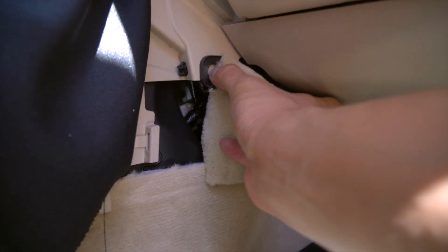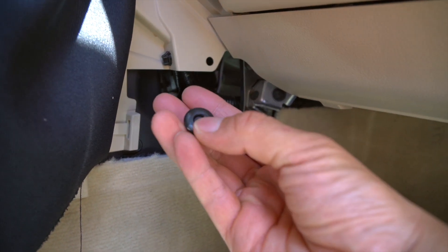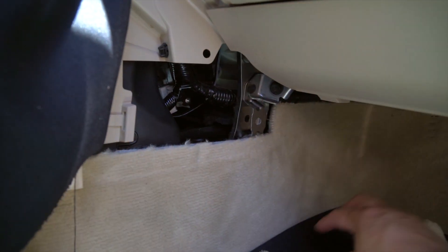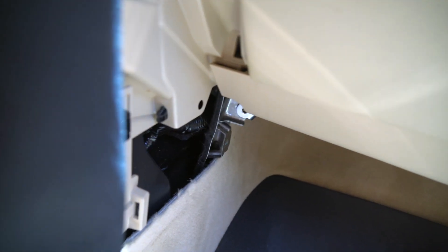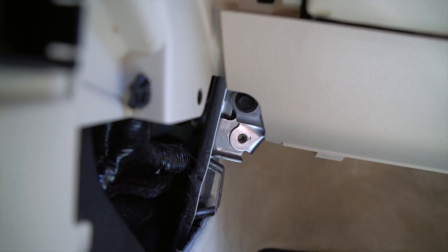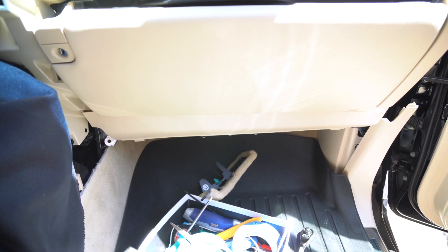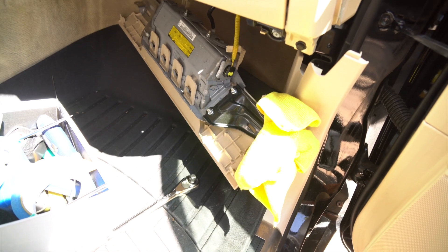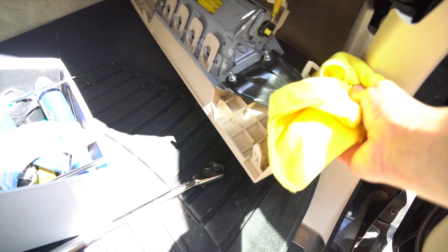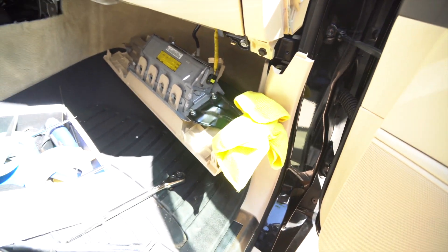There's another piece we removed over here — it was on right here, a little clip holding it in this hole. All you have to do is press in the middle to release the clip, then pull it out. Once you do that it exposes the 10mm bolt we need to remove right here. There's also one more 10mm bolt hiding up here — right there. All four 10mm bolts have been removed. Now we're ready to drop the airbag, removing all the clips from one side to the other, and it will just drop. Once it's out, let it hang and use some cloth to cover this area so it won't scratch any interior parts.